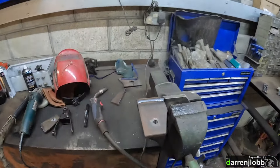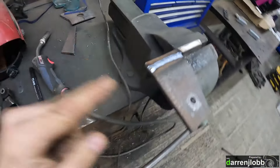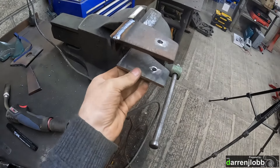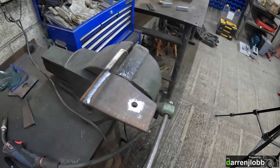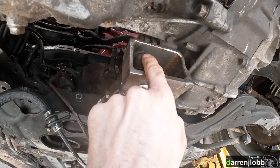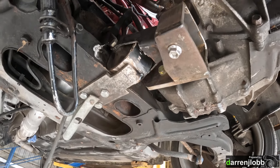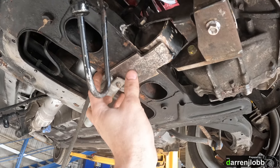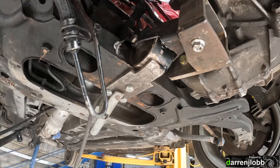I've just started welding together the first few pieces. This is the piece that's going to bolt up against the transmission — that will carry the bottom of the mount. We'll have a second one of those on the other side, plate it in, and come off the top to pick up that bell housing bolt. We've got that bolted up now. The mount is in. I'm just figuring out how I'm going to bolt the actual mount to the subframe — weld that outer bush support to that plate there. The plate then picks up three bolt holes to the subframe.